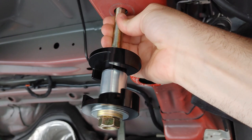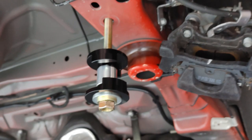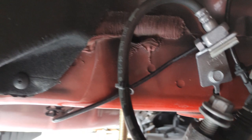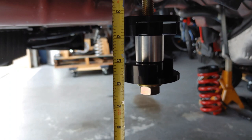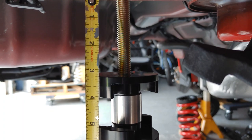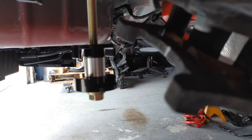About two rotations roughly - let me get the tape measure. So this is real deal, that's how far you can lower the subframe down. We have three and an eighth inches exactly - you've just lowered your subframe down that far. By the way, if you have the inspection hole there you can actually look in and see the stud sticking up, and you'll see there's about two inches that protrude through the fitting with this stud kit.